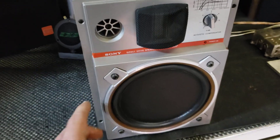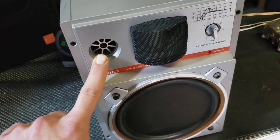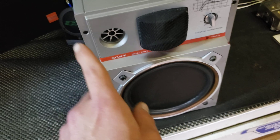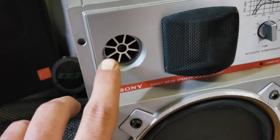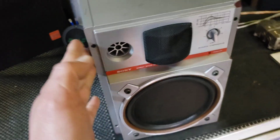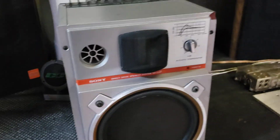The woofer has a cast aluminum basket and trim ring. This is actually an aluminum heat sink for the woofer. How that works is there's a heat pipe that runs from the woofer up to this port insert, and the woofer actually cools itself with an external heat sink. The port draws air back over the amplifier and over the MOSFETs to keep it cool.